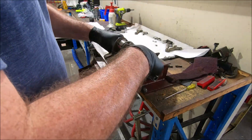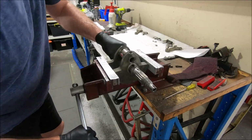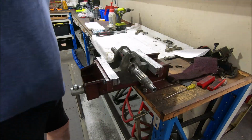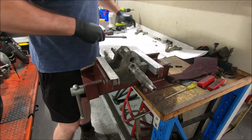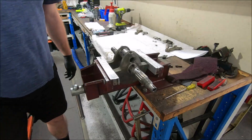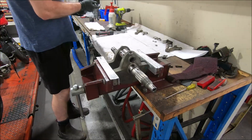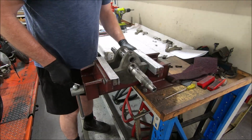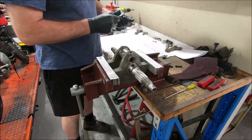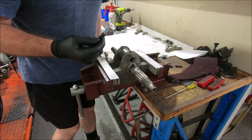So the cranks had a good wash in the parts washer, and then a wash down in Shellite, and then I brake cleaned the holes as well, because Shellite's still a hydrocarbon whereas brake clean is an alcohol. The plug for the big end, which looks a bit second-hand, is the same as the big block plug. I've got a heap of those in stock, which I keep for 900 engines from the 90s.